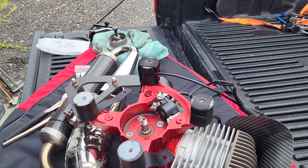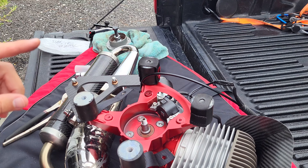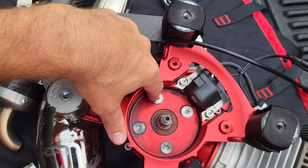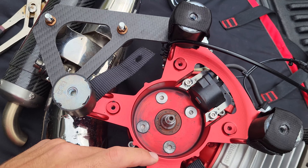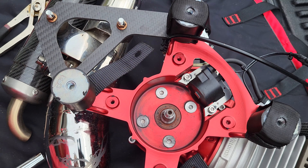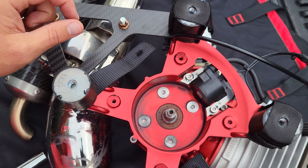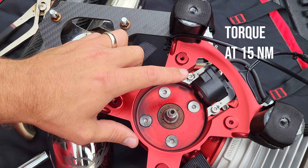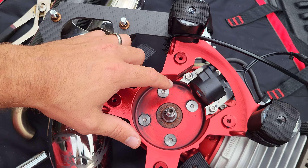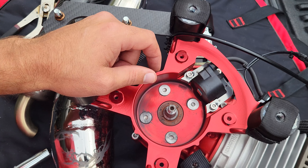Here is where we have had an issue — we're going to replace these screws. Inside the carter support there are four screws that connect the carter support to the actual engine itself. When I took this off the first time, one was about halfway out and one was almost all the way out; the other two were still in pretty good shape. I went ahead and torqued those down to spec, but I'm going to replace them under the recommendation of my buddy Francisco, who mentioned we should replace these in case the threads were damaged in the process of being turned out.